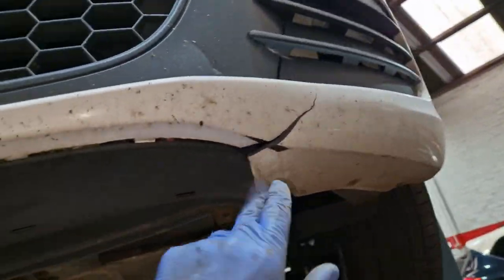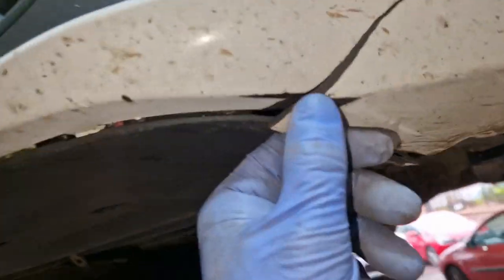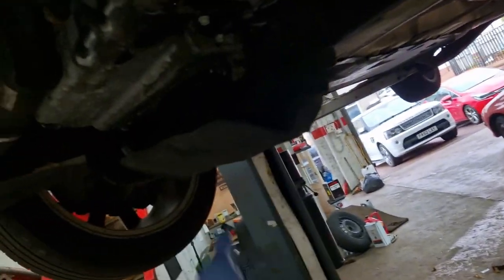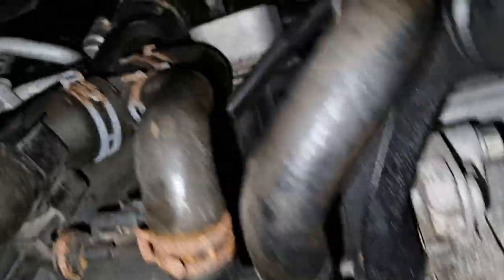There's a screw in there which is slack, and it is all damaged there, so that wasn't me, it's been like that. You can see it's been hit a million times, so it's been chunked there. This is all broke, that bit is all broke, that bit there is all broken, so this is just dangling. So the push clip's lost its tension or something. There's a bit of oil there, I don't see anything run down, it's maybe spilled stuff that's got trapped on that cover. Or a crankshaft oil seal, but I don't think it looks active, to be honest with you.